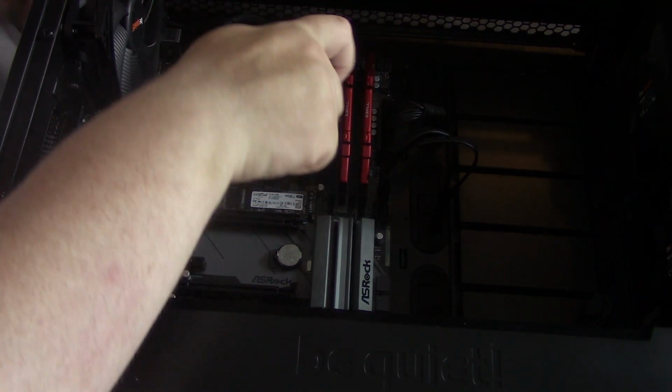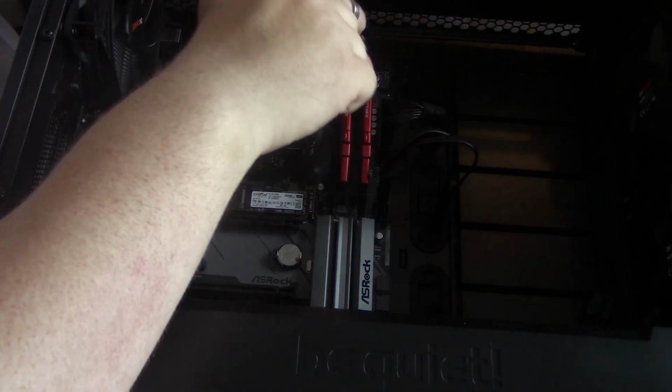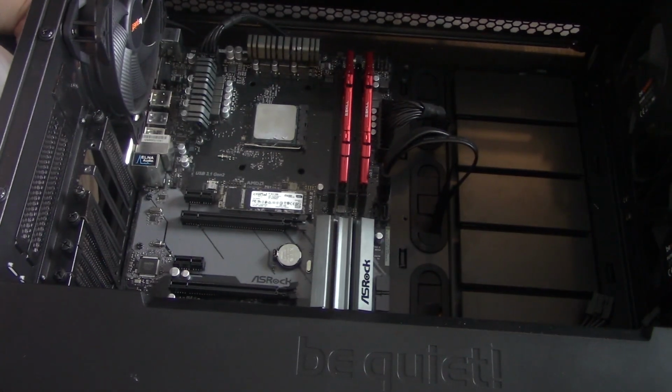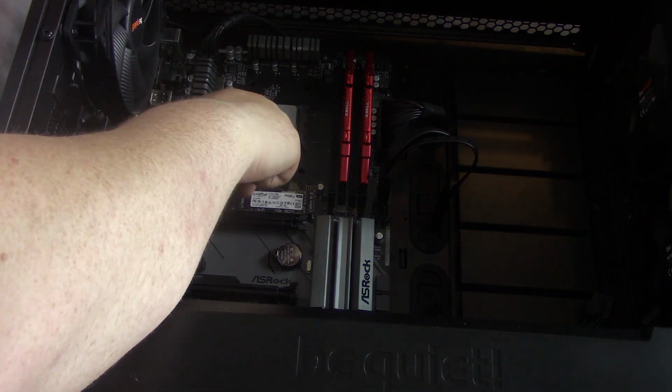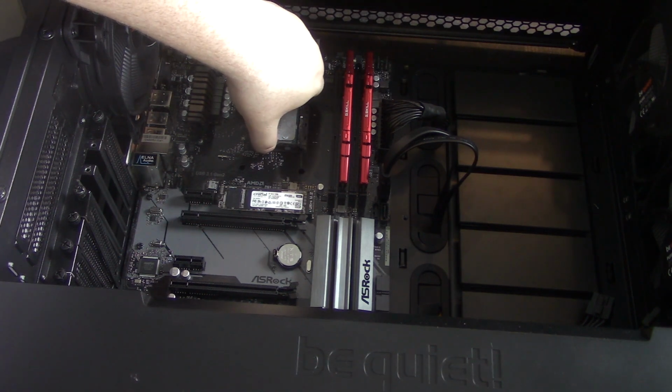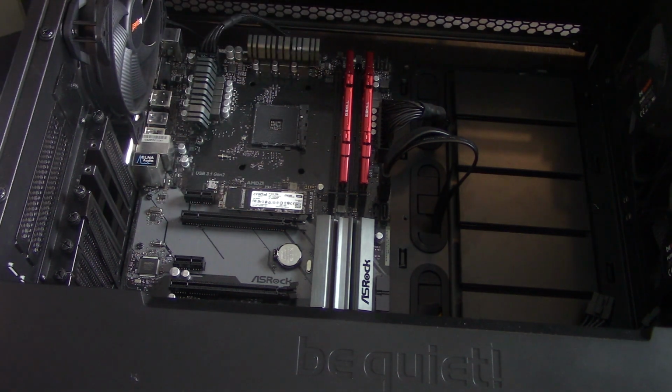Okay. And as you heard there, it just fell off. You take your new CPU out and place it somewhere very safe. You can, if it's going to be pin facing down, make sure it's on the wood surface. You can also do pin facing up if you want to be careful.